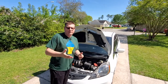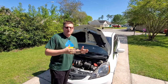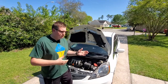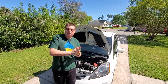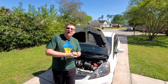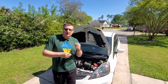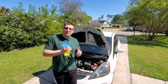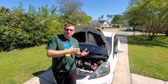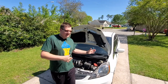So what about air in your system? This can happen too. You might have bubbles in your system, and you might think this could be the problem. Well, the thing is, your pedal is not going to be falling on you the more you press on it if you have a little bit of air in your brake system. It's not going to improve your braking by pumping the pedal, like I noticed earlier. So definitely in this case, it's not the problem.